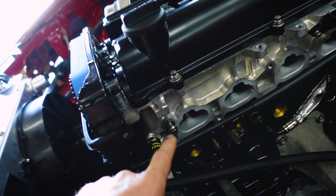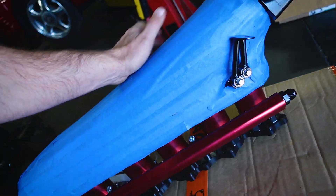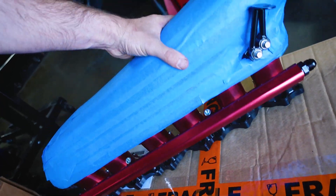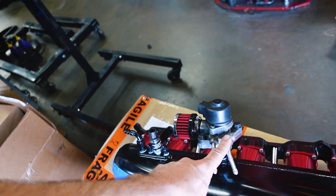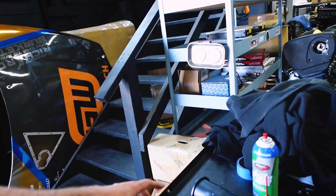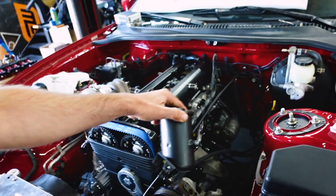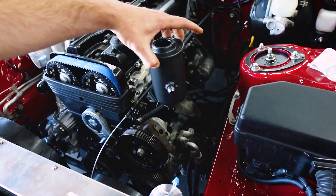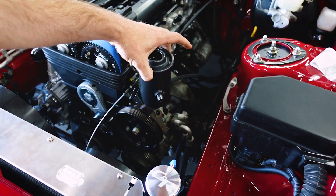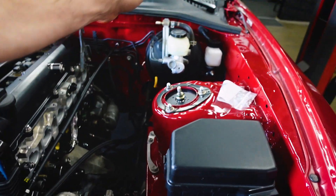We have a coolant pressure sensor and an oil pressure sensor - slowly adding all the parts. Check out this Hypertune intake manifold - we have it blue-taped on the other side while working so we don't scrape it. We made a custom throttle cable bracket in black with red to match the theme of the build. We still have the idle air control valve and map sensor under here and we're getting ready for the vacuum line plumbing. Another little trick we do: you take a non-turbo reservoir from an IS300, GS, or non-turbo Supra and use it - it bolts directly to the original power steering pump. That keeps it out of the way of the Hypertune's throttle body, which comes right where the reservoir normally sits on a Supra.